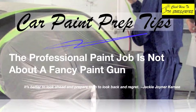And you don't wash the car before you start on it. You don't sand it really good. When you come to masking time, you just kind of throw some masking paper on there and tape it up a little bit. Then he comes in there with all of his ability and gives everything he has to producing a top-notch, high-quality paint job. Well, what do you think the car's going to look like? Car, pickup, or whatever you're painting. It's going to look horrible.